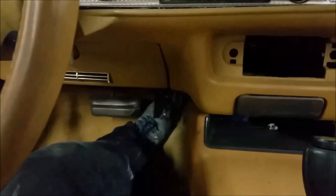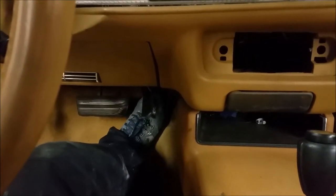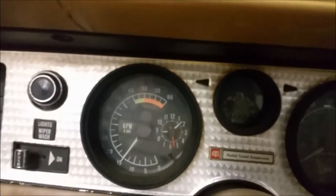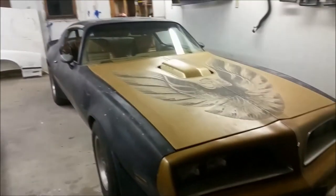Start it right up. Let's check the timing now — it's probably gonna move. Oh yeah, it's way down here — it moved with the vacuum advance hooked up. It's hungry for some gas. We're gonna give it some gas. Got her back together, so I'm gonna take her on a test drive and see how she runs.